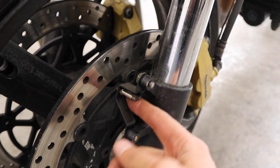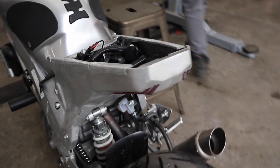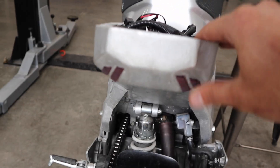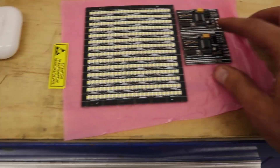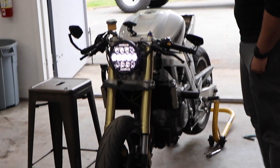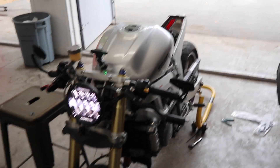There's a speed sensor right here — just made this little bracket for the gauge. The next thing he's working on is finishing off these taillights. He's done some new 3D printed resin taillight lenses and got in some LEDs. He'll break these into strips and wire in the controllers, getting all the lights and the gauge working. Then all he needs is his seat back from the upholsterer, and the bike will be pretty close to road-worthy.